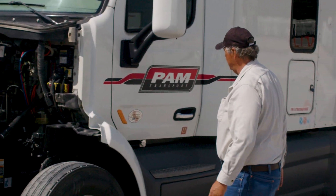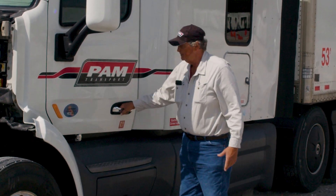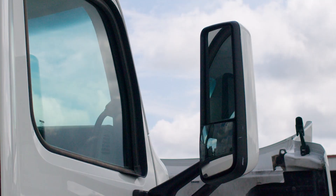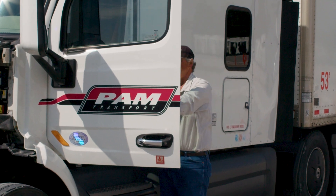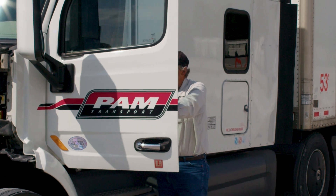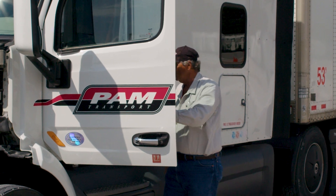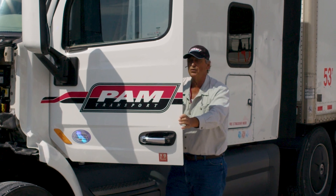From there we're going to go back to the driver's area. Check your door — make sure it opens properly and closes properly. The side mirrors are properly attached, clear, no broken, no illegal stickers on the mirrors. Check the hinges on the inside of the door — make sure they are properly secured, tight, and operate functionally. Check the inside handle on the door, make sure it will open. The seals on the inside of the door — make sure those are attached and not torn loose.